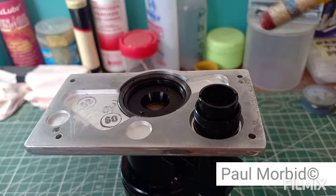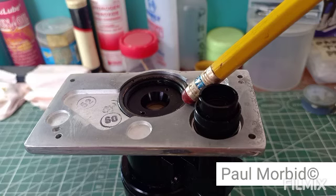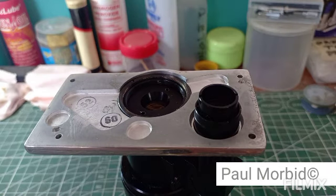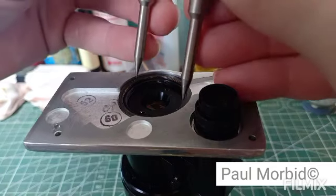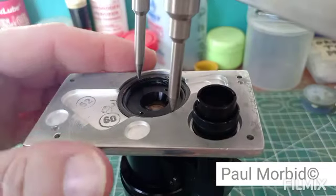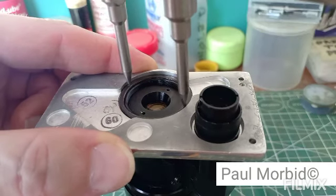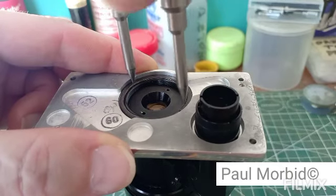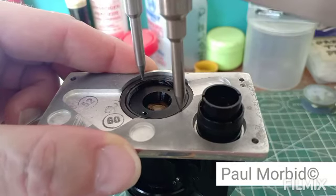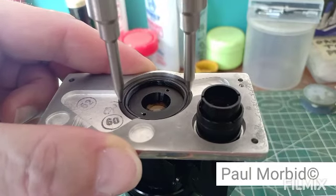Okay, so you've seen me show you how to twist the lens off. I'm going to show you how to, with these two little dots, how to put it on with a spanner. Spanner is this tool right here, and I'm going to put it in these two notches, 1 and 2, and you simply screw it on. All right, go all the way around it just like that. And you'll do this until it tightens. And it's tight.